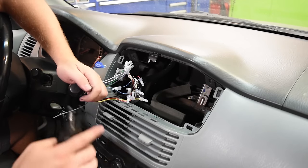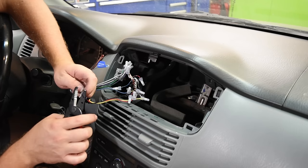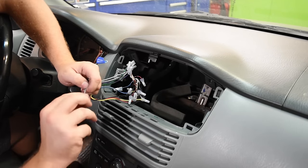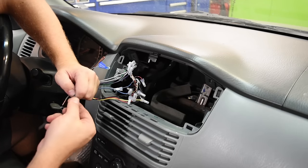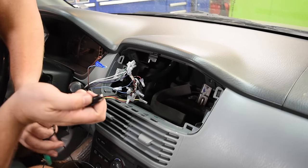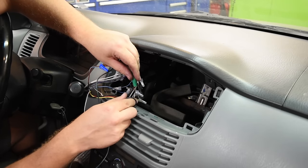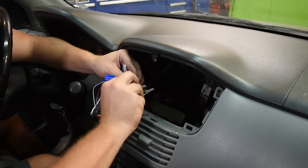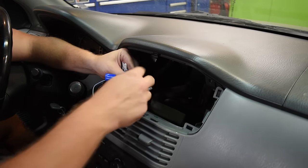The camera keeps shutting off because it's extremely hot in the garage — apologies for that. We're down to the right front speaker now, verifying we get a speaker pop out of the right front door. We can hear that pop from the right front door, so we'll hook that up and all the wires are just about complete.